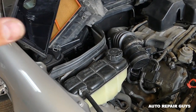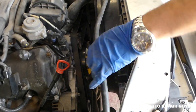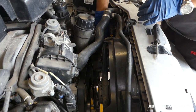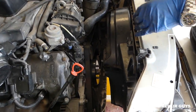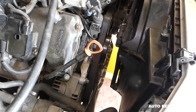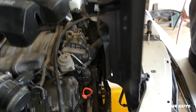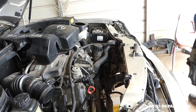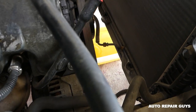We removed the air box to have more room — super simple procedure, we have the video on our channel if you need it. Now, they didn't install the right clips on the fan, so we'll have to remove those clips and disconnect the wires for the fan. Once you do that, you'll be able to pull the fan up just a little bit on both sides, move it one way to get it out, and pull it straight out. Now we've got to the radiator and we have a few things to disconnect.